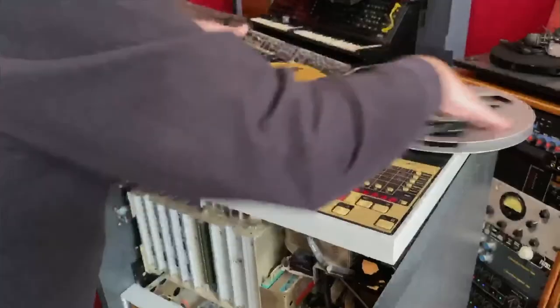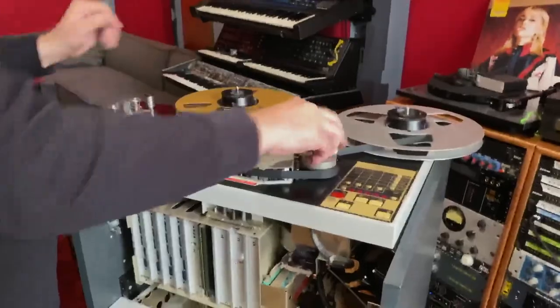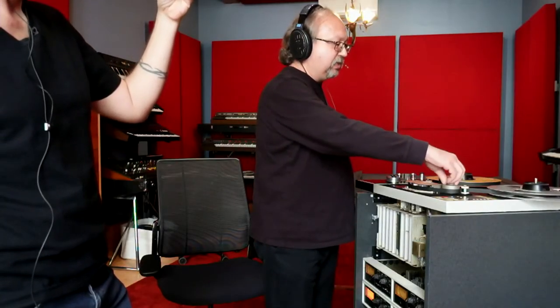And to me, what it does is it brings back memories of when 250 was our stock tape. The normal tape we used to use at the Hit Factory was 456, and we would align it to 370 nanowebers, which is plus 6 over 185. The people who really loved 250 were Tom Dowd, with the Eric Clapton sessions, we used to align for 250, and Toby Scott with the Bruce Springsteen sessions used to ask us not to use our house tape. He said he wanted 250. The smell of this tape brings back fond memories of those sessions, lots of them at the Hit Factory in the mid 80s when I was the chief of maintenance.